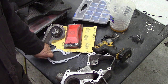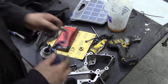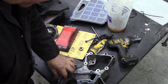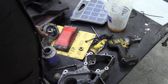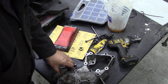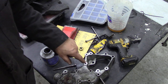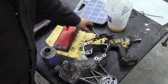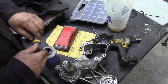I'm just going to get a little bit of Hylomar on this gasket to save a bit of time. I'll put some blue Hylomar on that gasket because it's paper — it'll soak in and make it a bit softer. So that's that done. With our pump good, we're going to pop that on like that. We've made sure that these holes are all nice and clean — these ones here — so these ones are clean.